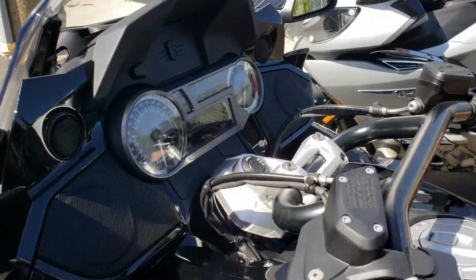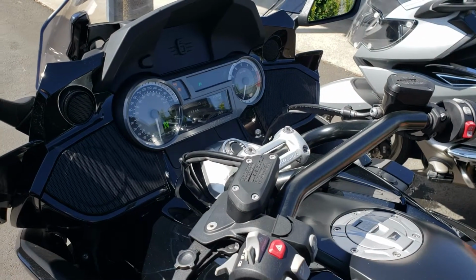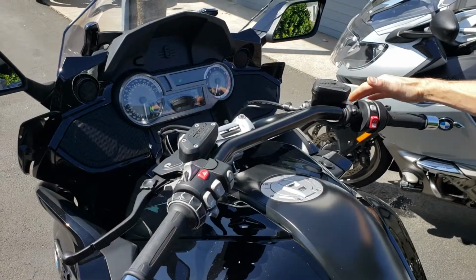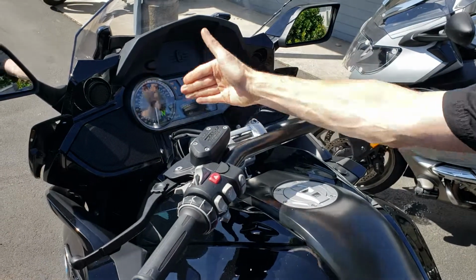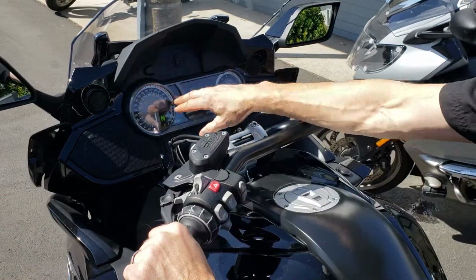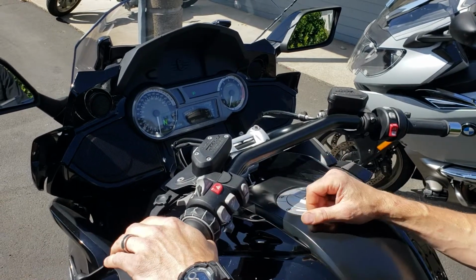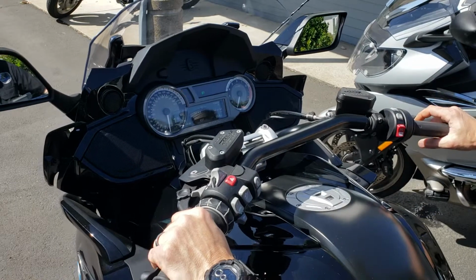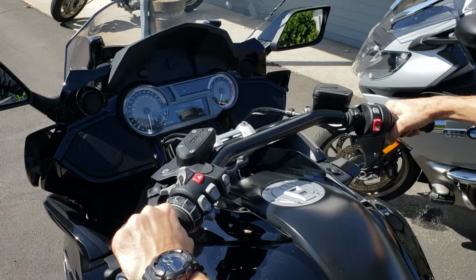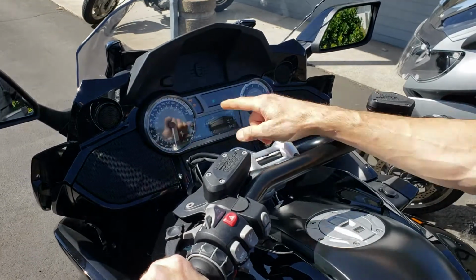If I pop into neutral, that hill start is on. So in your driveway, I wanted you to just check and see on flat ground, can you, in neutral with the bike running, give one squeeze, hill start on, pull the clutch in. If you're saying right now, this is when hill start goes off just by engaging the clutch, that you're right, that should not be happening. If you pull in the clutch, give it a little gas, and then don't move, that just disengages it, because I tried to start moving and then I didn't, and now I've lost the hill start.